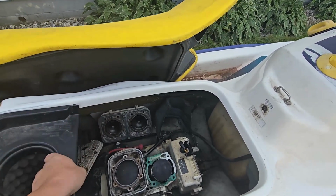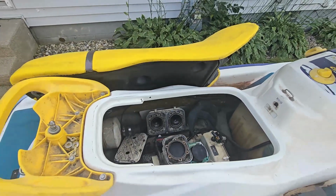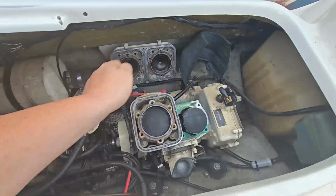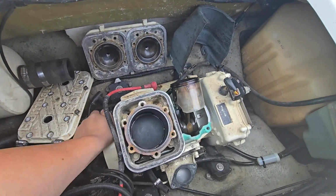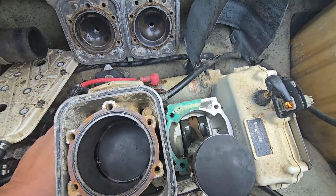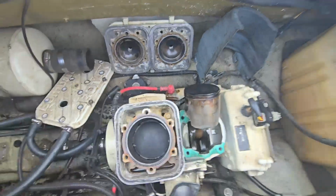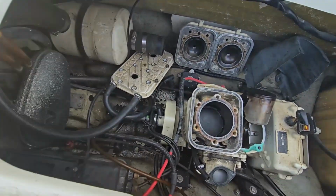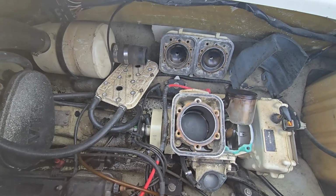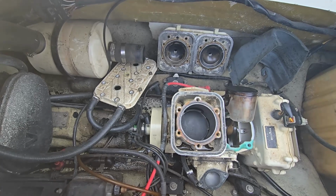Okay, we'll move our airbox funnel. So as the pistons do move, she moves freely. She looks good. Just this jug was frozen. He didn't keep it, so I don't have that jug. But we're going to pull this engine out and we'll redo a top end. We'll probably have that crank inspected just to make sure.